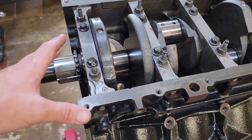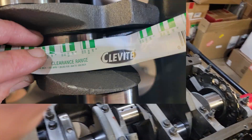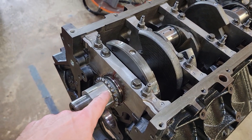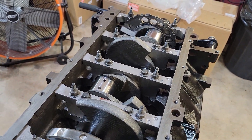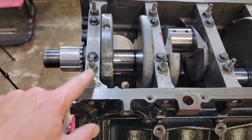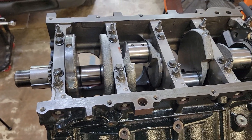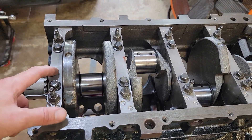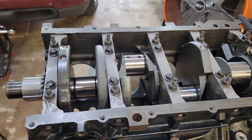I've already got the crank in. I went ahead and checked the clearances on all these journal bearings and they are all perfect. I did do brand new bearings in there as well — I was a little nervous they might be too tight or too loose in some places but everything looked great. I am gonna do ARP studs. I just decided on that — figured putting ARP in everything else, might as well do it on the bottom end. These are in here for now, torqued down, and once the ARP studs come I'll take these out, put the ARPs in, torque them to spec, call it a day.